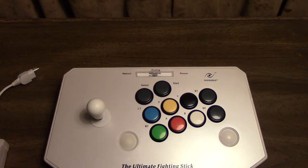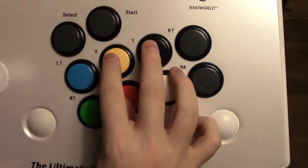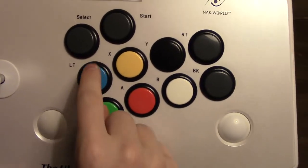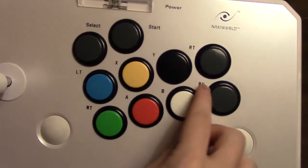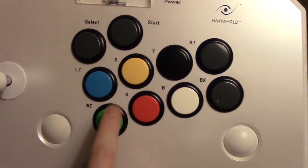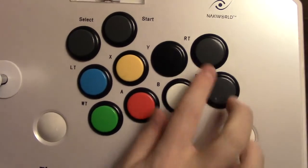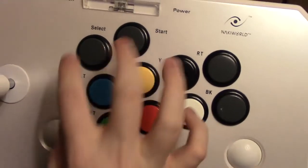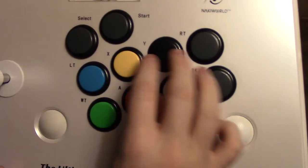The original button mapping was something that I hated. You can see it's actually labeled according to the original Xbox controllers — four face buttons, your first two shoulder buttons, and your other two shoulder buttons. I don't like this design. What I changed it to is: it's still labeled the way it was originally, but I remapped it to be your A, X, Y, and B, then Black, White, and then your two shoulder triggers — left trigger, right trigger, plus start and select. That stayed the same. So now when I use the joystick, I use these buttons instead of those — just personal preference, but you can map it to whatever you want.